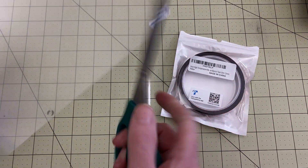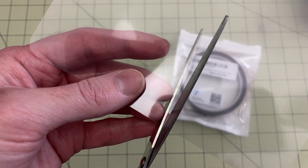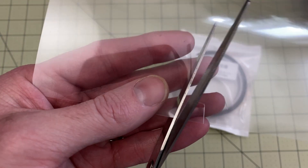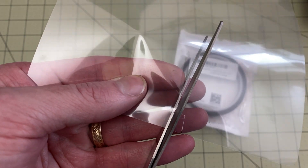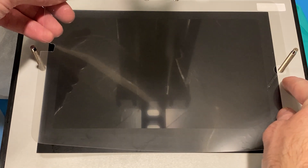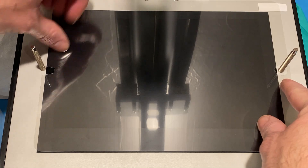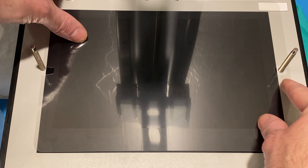There's a part for what would be a microphone on it, and we're going to actually use that. We're going to take the scissors and cut this spot out to this hole, going just a little bit wide and cutting to the edges just like that. I just cut a slot there. Now this is why we use this specific protector — see that one hole right there? See this post? That is going to go right over there, right in the center. We're going to apply this and get it so it lines up right here with this other post, and that will get us all in place, covered and protected.